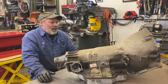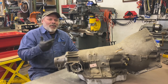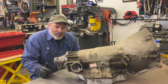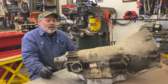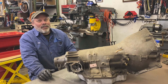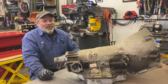Dropping the pan gets about half the oil out. And the new guy — you can only do so much, especially when people are new. Maybe the night before, he or she just pulled the transmission out and had it sitting on the jack under or next to the vehicle and they dropped the pan. They didn't plug all the holes. Well overnight, the torque converter is still full. It's gonna drain back and it's going to find its way out mysteriously through every open hole. That's just the way it goes.